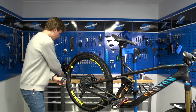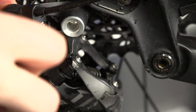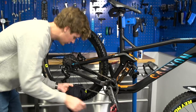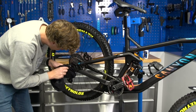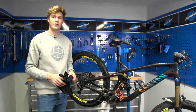I'm going to apply some of this wet lube now, and I've got three places I like to apply it to: onto the chain of course, then onto all these pivots on the rear mech, and then just onto the bearings of the jockey wheels to keep everything running smooth. Finally, I'm just going to get rid of that excess lube — cleaning up the chain, jockey wheels, and also around the rear mech. And that is it. Job done, and I'm ready to get back out and hit the trails.